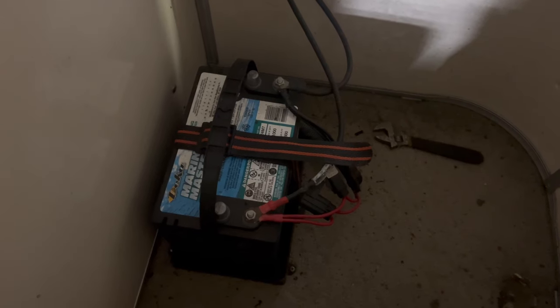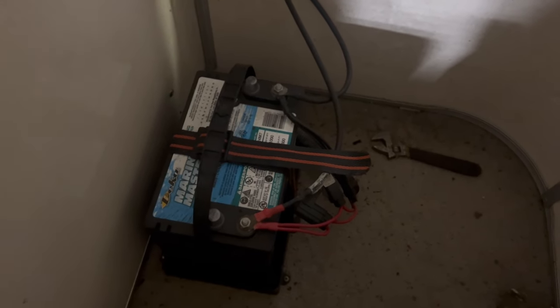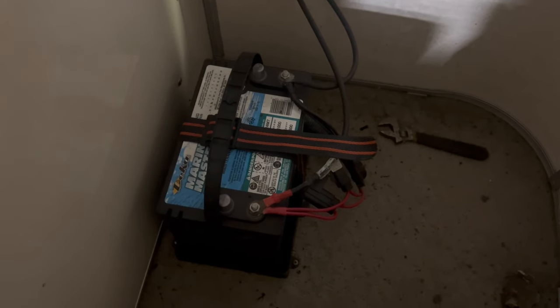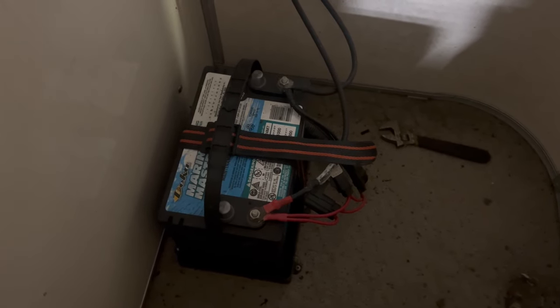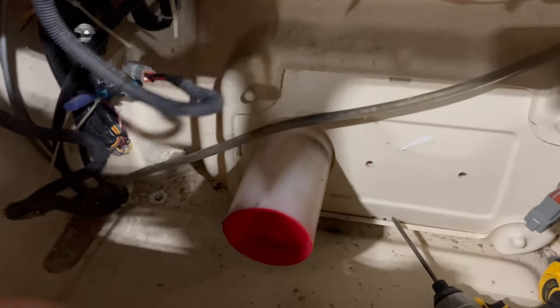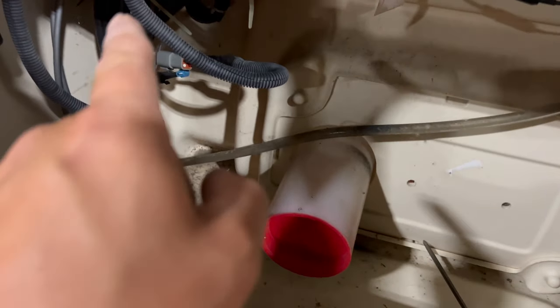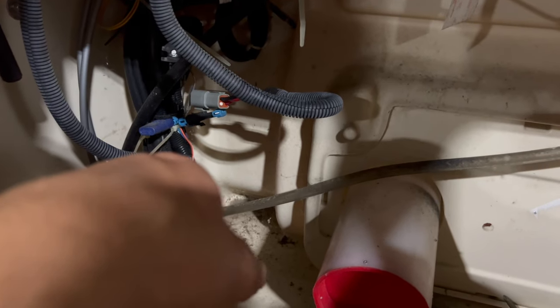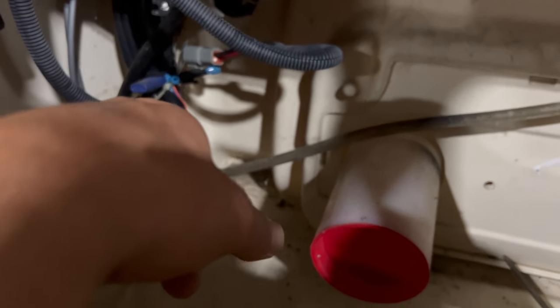Just trying to simplify this for you so you're not overwhelmed when you tear into a project like this. Before you start going crazy, make sure you unhook your battery — nobody needs to get shocked, and we don't want to trip any breakers or ruin any electronics. With those wires unhooked, I'm going to leave these dangling in here — it's not going to hurt anything. Now I can move on to the bundle back here — that's the ignition harness coming up through — and go ahead and cut that free so I can sort through.